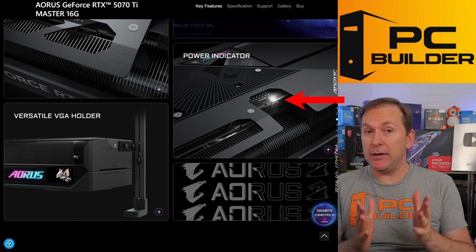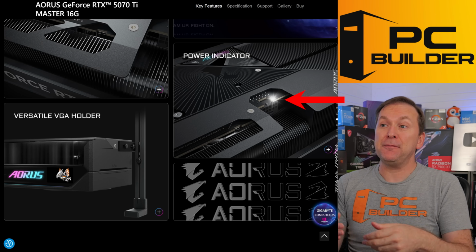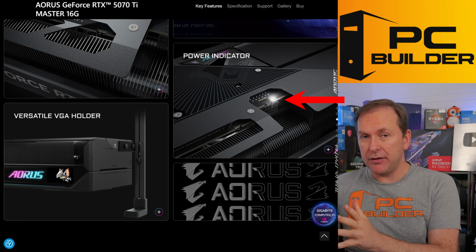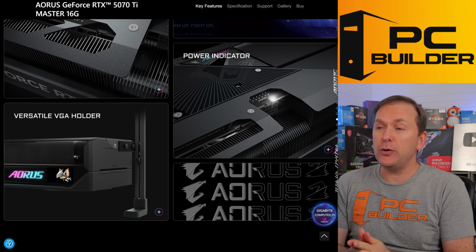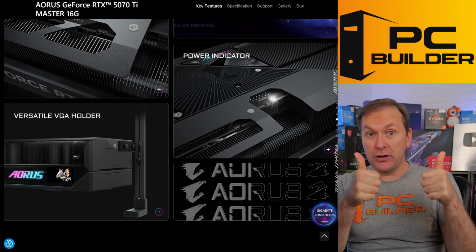If it flashes, that means there's issues with the power delivery and you should fix it basically. And if there's no white LED, it means it's not fully connected. So I absolutely love this. I think every RTX card going forward, if they're going to continue to use the 12-volt high power cable, should have an indicator like this. So 2 thumbs up there.